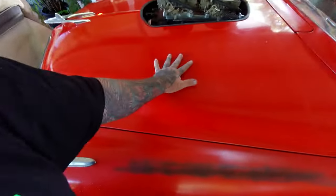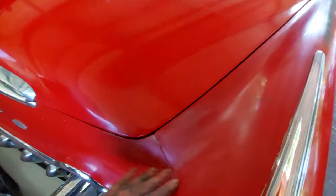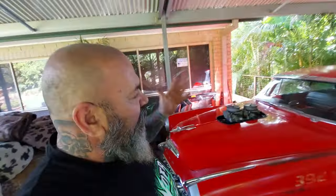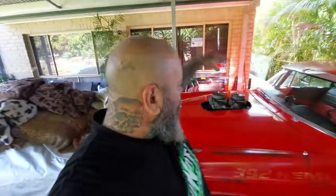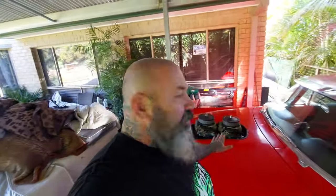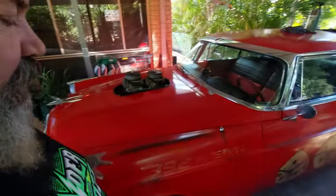We're going to add some patina onto the bonnet. Here, there's some weird stuff happening, so we're going to get a bit of patina there. You just got to look around it. The sun will bake top edges more, okay? It will bake on the horizontals more than the verticals. So the horizontals have to have more patina on them. That's why we do a bit on the top of the guards. Now the sides may still have a little bit.